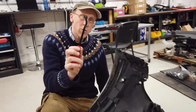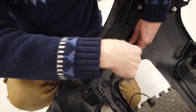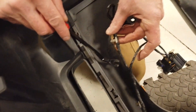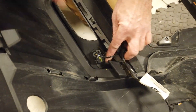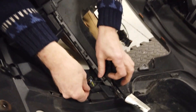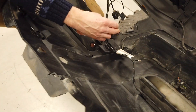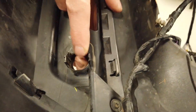We're going to need one of these little snake's-tongue trim tools. The bump strip here is on little fir tree fixings, so let's start there. We hit our first parking sensors — they've got two little ears that stick up and we've got to spread them sideways. Push on the sensor and just spread those two little ears apart. That's the first one out.